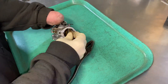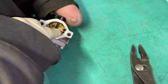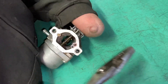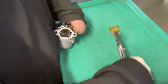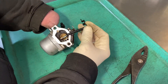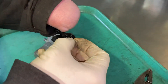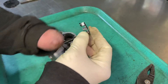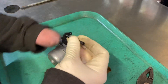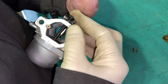So what we want to do is pull this out. These are just plug and play — you pull it out and push them in. A pair of pliers. Just make sure you remember how they go by looking at how they are now. You've got two little half moons right there — they seat properly right here, so make sure you remember where they go. Be careful you don't bend this; pull it straight out. It comes right out. Now this is going to come out straight up — it's going to be a little bit tight on the one that doesn't work properly. Make sure you remember where that spring goes. The spring tab goes up top and pushes against this plate. This is the plastic choke guide — it's plastic. What we've found is the bottom of this gets very swollen, you'd think hard plastic wouldn't swell.